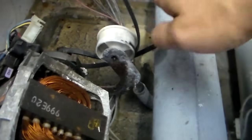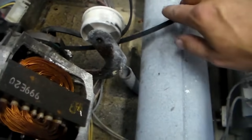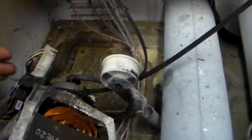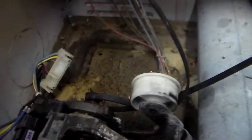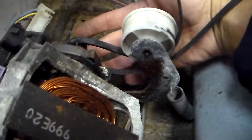The tub's going to lay right over top — this side goes around one side and this goes around the other. You're going to do that with two hands at the same time. Your left hand reaches under and pulls the pulley over, because if you don't pull that pulley over the belt's not going to be long enough to hook it over top of the motor. That's why you reach in with your right hand, push it down, reach it over, and hook it.